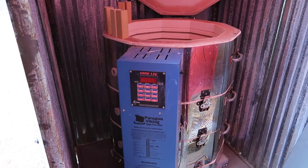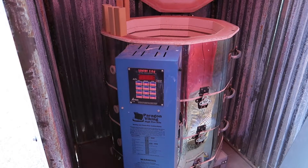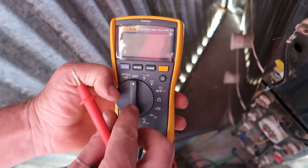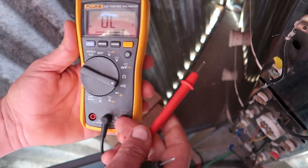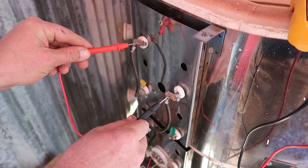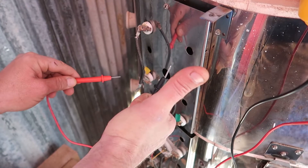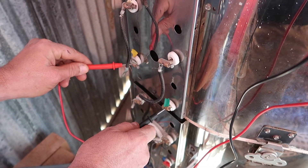The first thing I'm going to want to test on each element is whether or not I have connectivity through the coil — whether it's broken. That's a real easy test. Set your multimeter to an audible beep, and then work your way down the line. On mine, I found three of the six elements to be broken, leaving me three to come back and do further testing on.